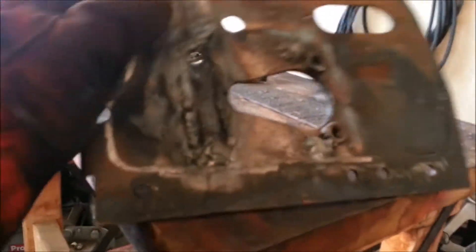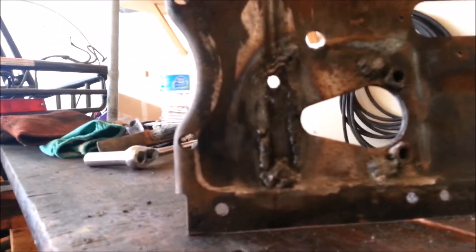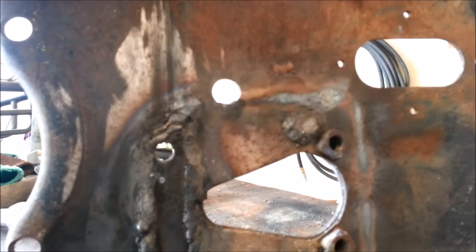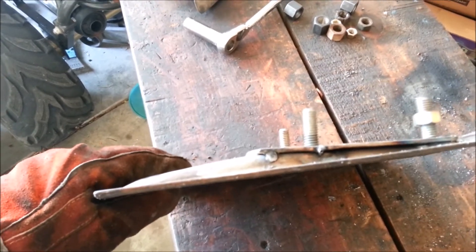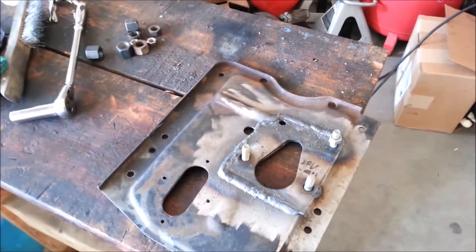On the back side, this was the first welding I did so please don't judge me. That's why I welded the back side, just to try and get a little penetration. That's where I bent it. They got good penetration, so I went ahead and welded the front as well — I was just trying to learn. I don't have a lot of scrap. Then I just welded three bolts here to make the studs for it to fit on. I'll take and clean it up — there's a piece that overlaps there. I might cut that off, grind it off, and then weld it to make it one piece. I'll finish metal work all of this so I've got a good flat surface.